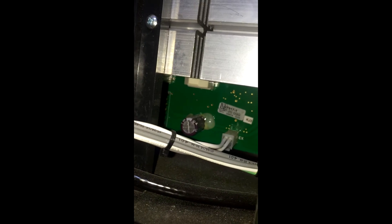With the plug out, we're looking towards the front of the machine on the other side. There you can see the multi-pin connector that we're going to plug the adapter into. You want to be super careful — try not to touch the motherboard or get any static electricity in there. The connection only goes one way; the tab is to the front of the machine. I'm using needle nose pliers to hold an unused slot on the connection to get it plugged in.